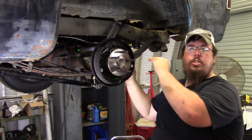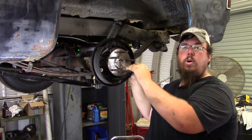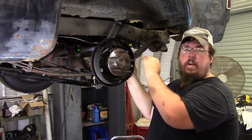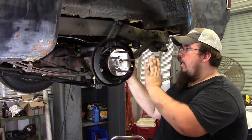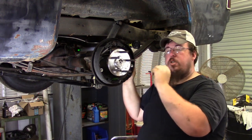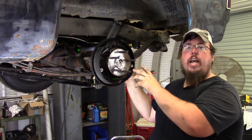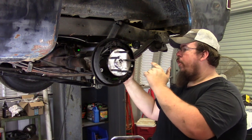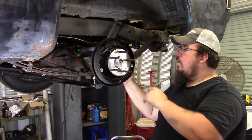And on mine, it just took a very slight kink to get the spreader bar to miss the C-clip eliminator. But everything lined up, and the brake shoes and all worked just as factory. And everything lines up depth-wise. So these axle shafts are pretty much basically a direct factory replacement style shaft as far as the dimensions go, other than having to cut the housing down for the C-clip eliminator.